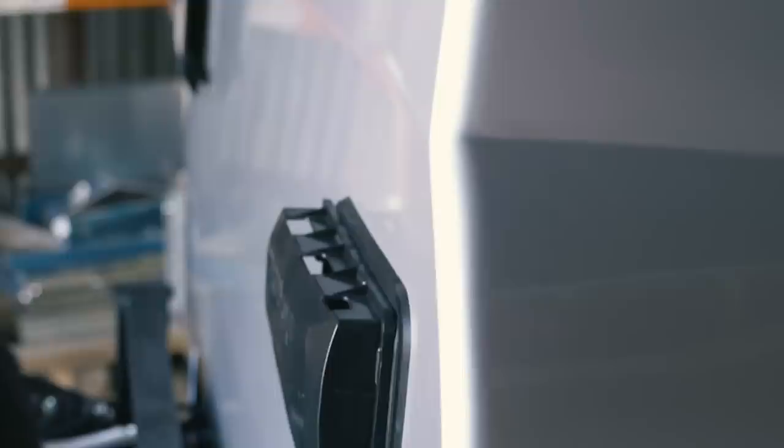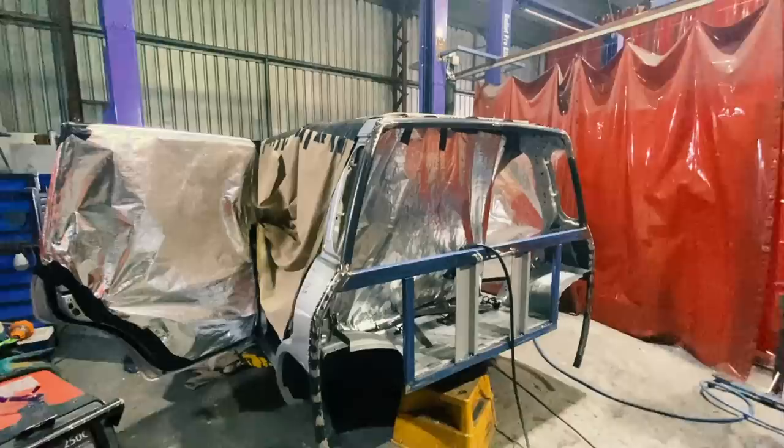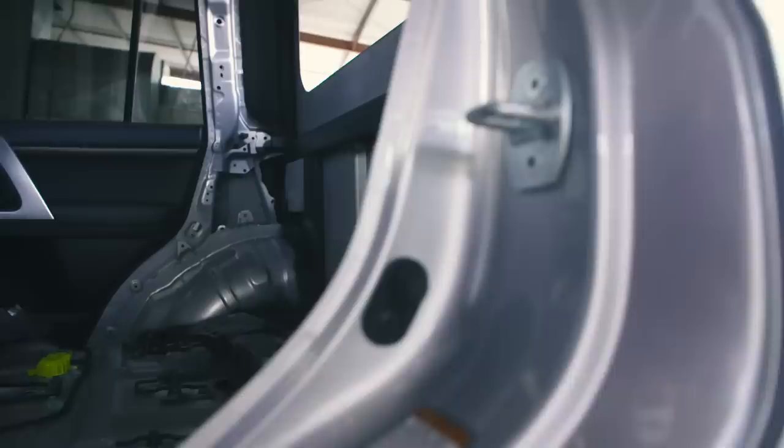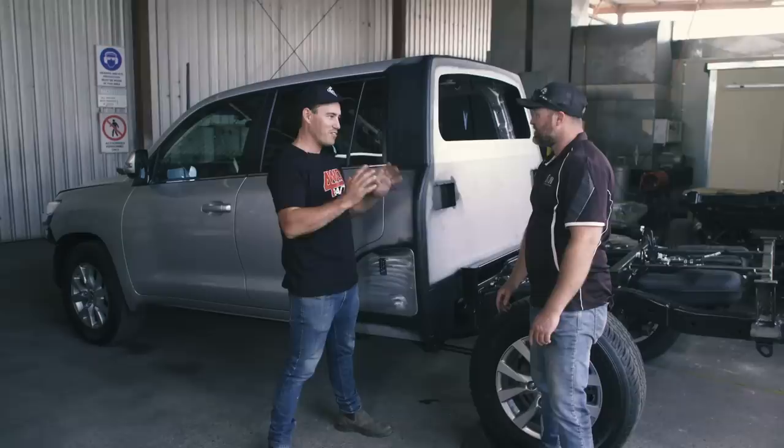The main filler is just where the two sheets meet — they come together on the side and back, fully welded down, and just between the two sizes of sheet is where the filler goes. A lot of people probably wonder why it doesn't have the dimples on the back like a lot of other chops, but you've got the strength in this one. There's all RHS framework through there, and the reason for a flat wall is that when you're touring on lots of dirt roads, the ribs build up dust and start to rust out. With the flat wall that just runs straight off — you've got no chance of corrosion.